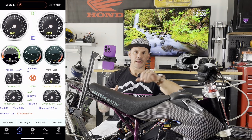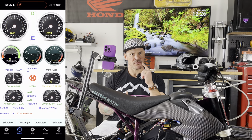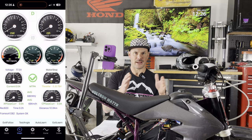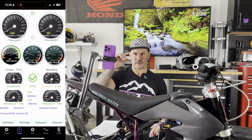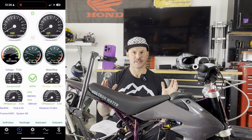I held the throttle down, it went forward, it went back. You can watch the gauges. Sometimes if you're doing this for the first time your motor might sound a little gravelly, but as the auto learning process takes place it's figuring out where it is and it's going to smooth out. We did get a throttle issue, but once it verified the system was okay it removed the X and gave me a green check — which is bueno.